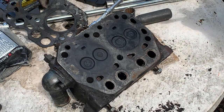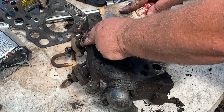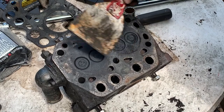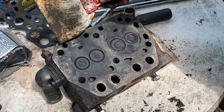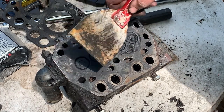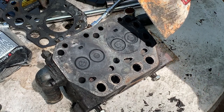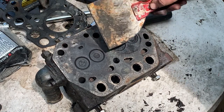Plus, you want to torque these things down in sequence, like you would do this one, right? This one, then this one, and this one. And you would torque it to, you know, maybe 30 foot-pounds on the first go-around. Then come back to maybe 60 foot-pounds. Then come back to 70 foot-pounds. And keep doing the same thing.